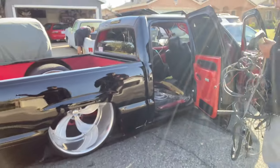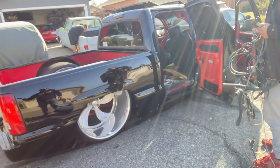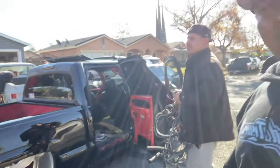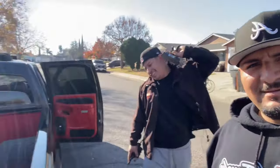This truck has regular valves, it has AVS, and my tank in the back. It burst because my pressure switch got stuck — so my compressors stayed running too long and then it burst a line. Harro Customs came to the rescue and fixed it for me, so now we're going to replace all that.